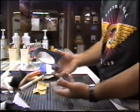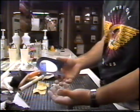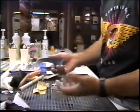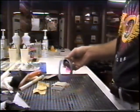how significant they are. Somewhere down the road you realize, oh gee, wouldn't it be nice to put more nose weight? Oh gee, and I hate to put it on this crankshaft. Oh, I'll just put the heavy cowl on. It's a 1/4 ounce heavier, half ounce or whatever. Bingo. So that's one of the choices we have with this kind of a system.